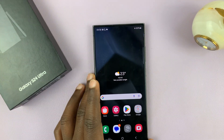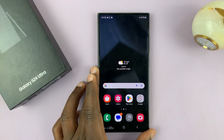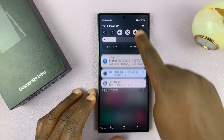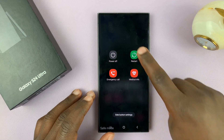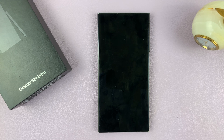That's how to put your Galaxy S24 in safe mode. Now to exit safe mode, simply go back to the power menu, tap on the restart button, tap on restart again, and that should restart the phone back into normal mode.